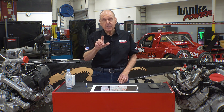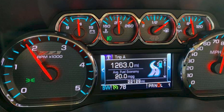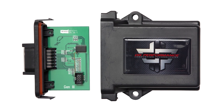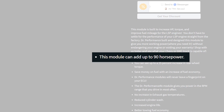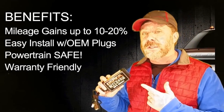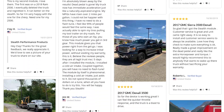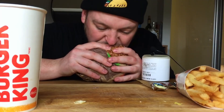As to their mileage claims: the ECM doesn't know about the additional fuel, so the fuel economy reading on your dash will be wrong. It displays better fuel economy when in fact your air-fuel mixture is richer and your mileage is worse. We've found that most of these boxes have the same electronics inside, but with different housings and brand names. Despite claims of up to 90 horsepower gain, they all added the same 14 horsepower. Sold by online hucksters, the success of these mileage boxes depends on customers duped by the huckster's song and dance or deceived by fake five-star reviews. There is no way you can add fuel and save it at the same time — it's like eating a double whopper with cheese to lose weight.